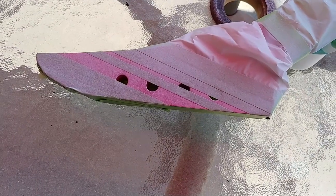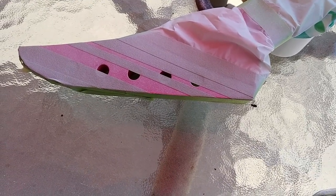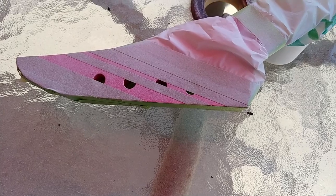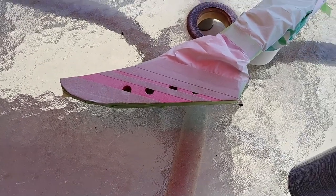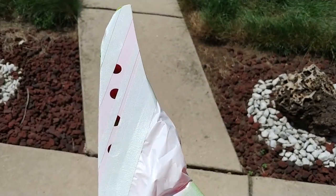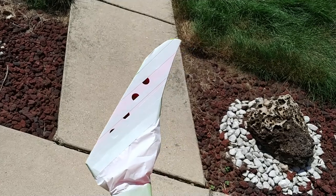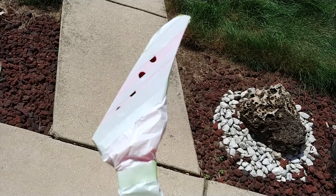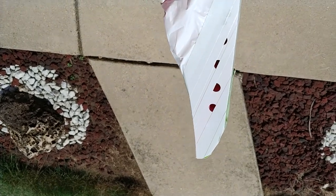The first coat I'm putting on here is a very, very light dusting — kind of like a tack coat. The next coats are going to be basically the same thing. You want to go really light, you don't want to go really heavy, otherwise the paint gets underneath the tape and that's how you get bleed through. So you want to spray light coats. Alright, so you can see it's not as pink as it was before — it's getting there. There's going to be probably three or four more dustings and I should have the white I'm looking for. Alright, so that's the third coat — I'll put one or two more dustings and I should have the white stripe I'm looking for.